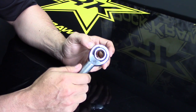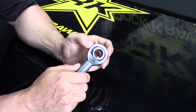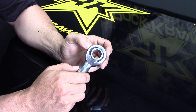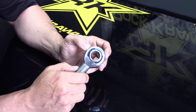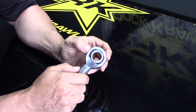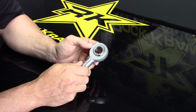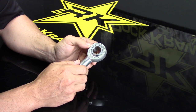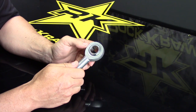They do have some good uses for some support linkage and things of that nature. And again, they are more cost effective than your very high-end ones that we're going to touch on next, but they do cost a little bit more than your standard commercial grade. So when you're looking at your Heim joints, check out the plastic raceways and be aware of what you're dealing with. Your best quality construction Heim joints for suspension, steering, and things of that nature are typically your three-piece units.